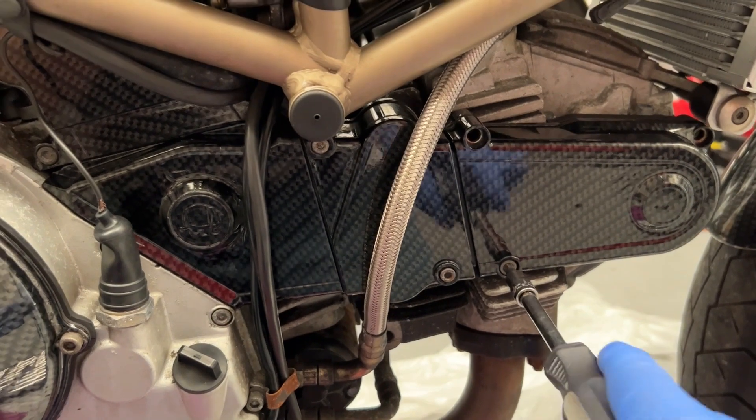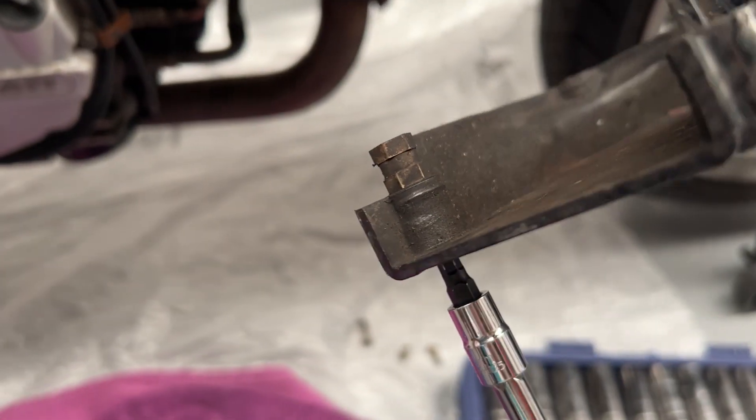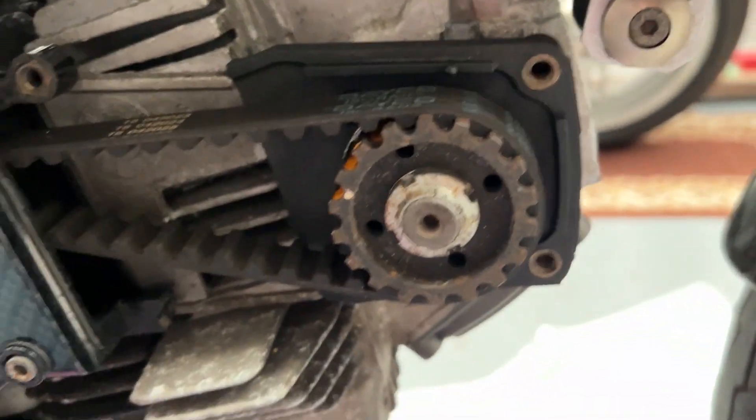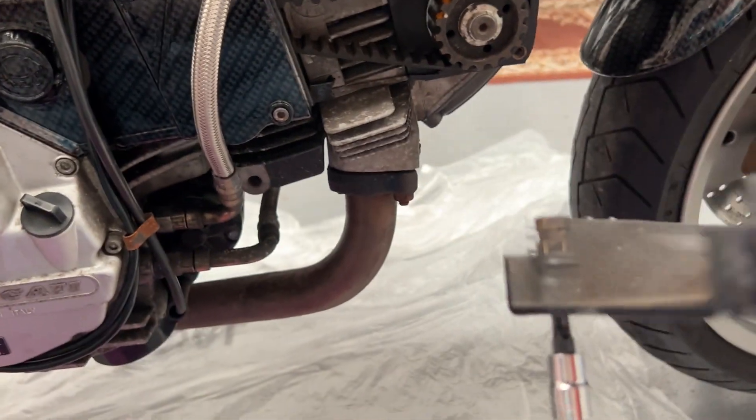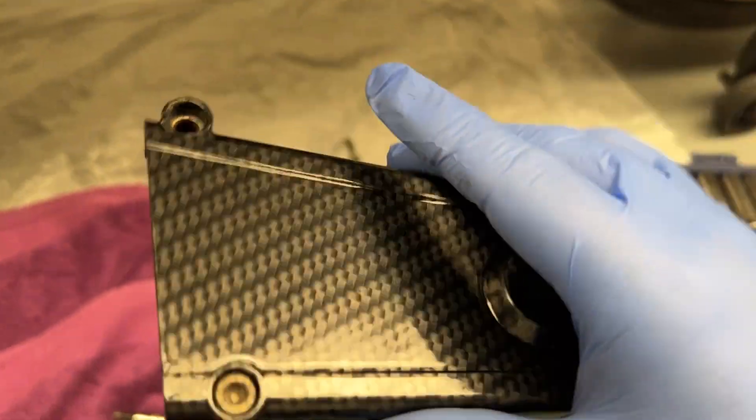Just to give you a quick example — just rotate, rotate... yeah, that'd be why nothing's happening. Because it's not actually attached to anything. It's all broken. I would say over-tightened and it snapped off there. So it was only these three that were holding this cover on, and they were tight to be fair. Our lovely bit of plastic is actually broken off and gone. So it wasn't crossed — it was just rotating in space.